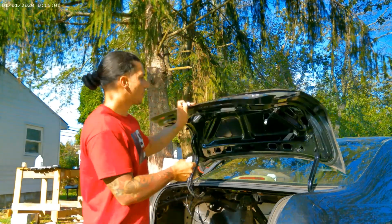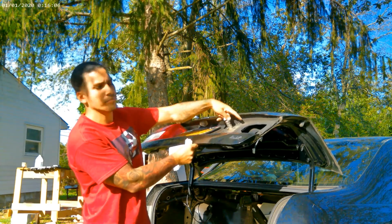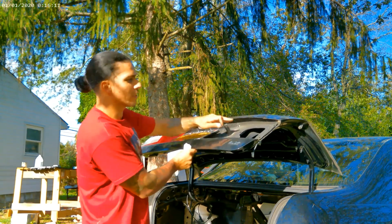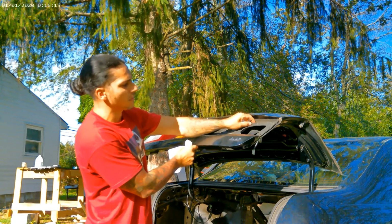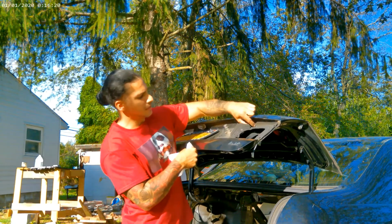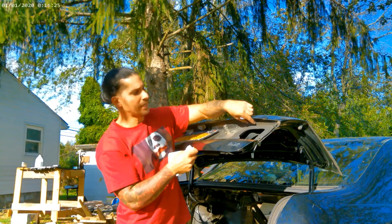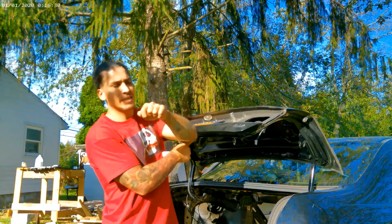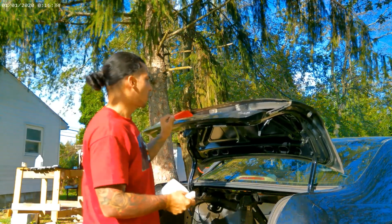So what I'm gonna do is place the camera right here and run the wire behind the light and in through one of these holes, so it could get sandwiched in with this rubber piece. I'm probably gonna lift the rubber a little bit right here, this rubber's kind of old, and make the wire go behind it, so when I put the light on and tighten it up, it'll squeeze the wire between the rubber and the light fixture, so the rubber will wrap around the wire itself.